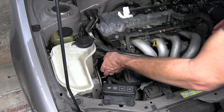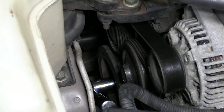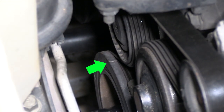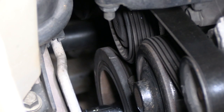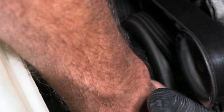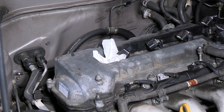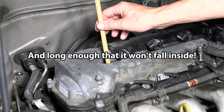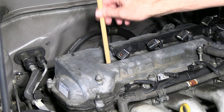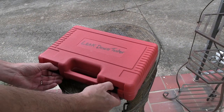I think I saw it move. The good thing about finding top dead center on cylinder number one is you also have the notch to go by — just get that notch to line up with the top dead center mark on the timing housing. That should be top dead center. We'll test it by sticking a little wooden dowel in there — a chopstick or something that's not going to scratch anything, something wooden or plastic. The piston should be right at the top, and we are. So we're ready to start our leak down test — let's open this up and see what we got.